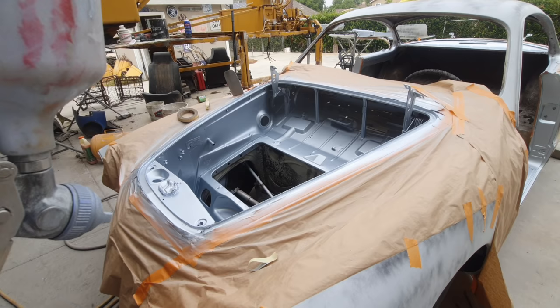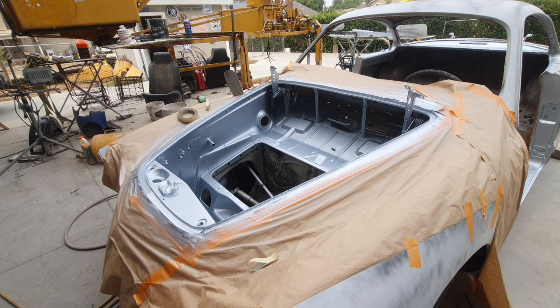My spray gun's about 1.5 turns out. I'm really putting it on dry. I don't want to waste a lot of material. And I'm using accelerator in with it, so this stuff's setting up super fast. So that's an example of what I'm doing. It'll probably be different when you're doing something, but this gives you the idea how to do it.